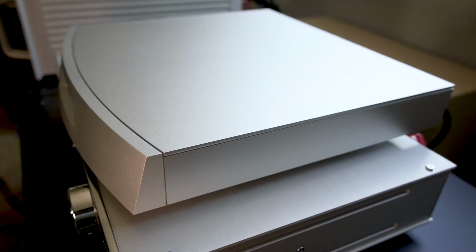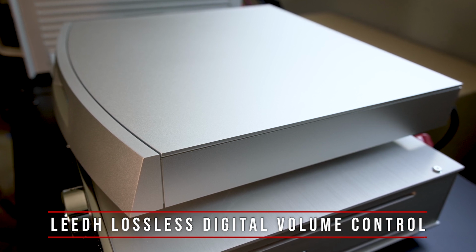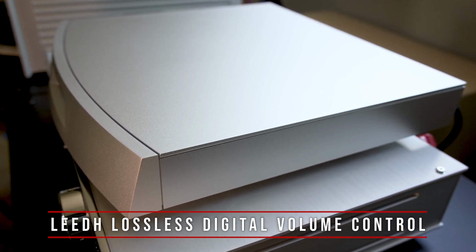The reason I'm harping on this is that the volume control in the Lumin T3 is not a conventional preamp. It's a digital volume control, and it's a particular kind of digital volume control called LEEDH. It's licensed from a French company, and the design of LEEDH means that the digital volume control really doesn't truncate any data and therefore impinge on the quality of the signal, at least that's the idea.